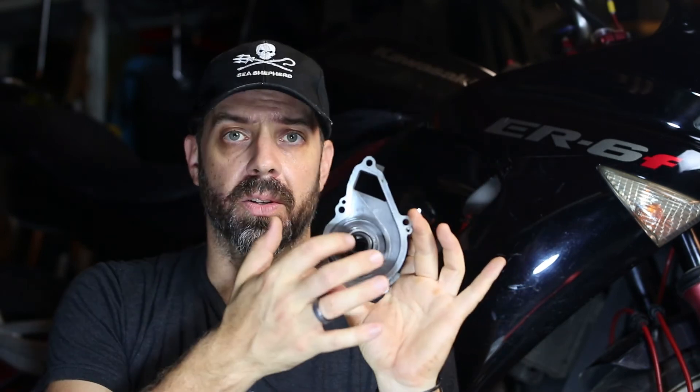That's definitely something you want to keep track of — maybe make a note of it in your logbook or on some kind of digital record. I just wanted to open that discussion with you guys: how often are you changing that mechanical seal on your bikes? I'm getting about 15,000 kilometres out of each seal. And how often are you guys changing your coolant? Are you waiting for it to start looking like this, or are you changing it once a year, or once every couple of years?